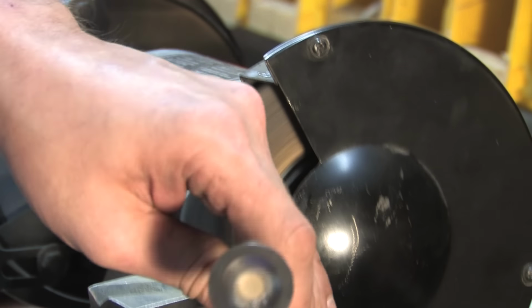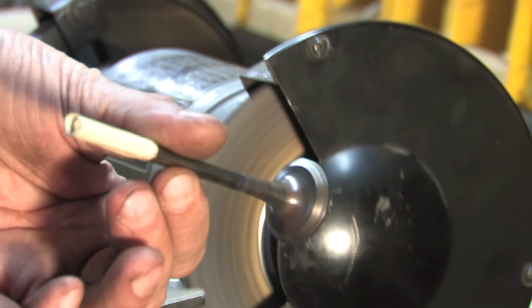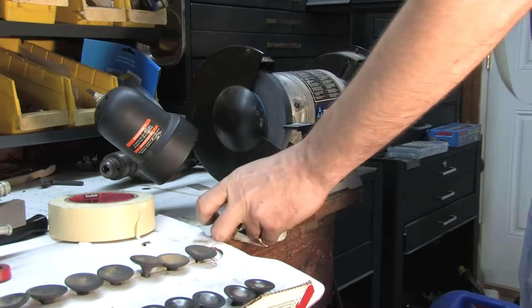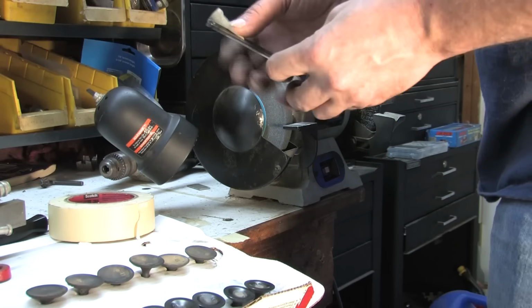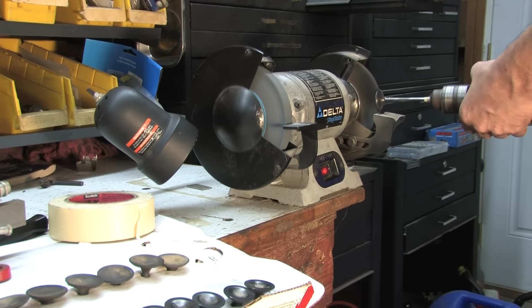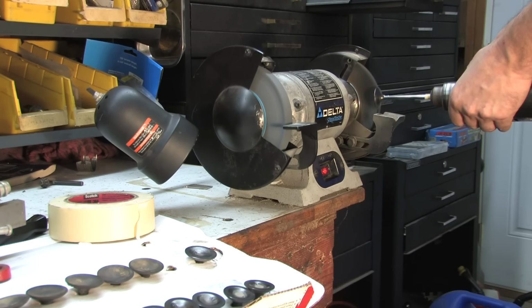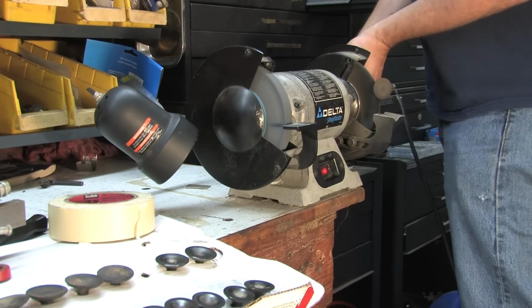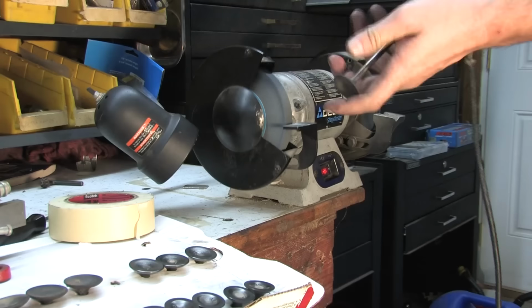That little bit in the middle of the valve doesn't matter. You just need to get the outside edges clean so that the lapping handle will stick to it. If this process takes you any longer than 2 minutes per valve, then you're doing it wrong. I cleaned all 16 of them in about 24 minutes.